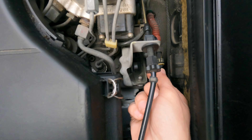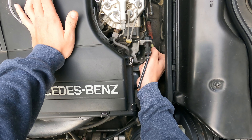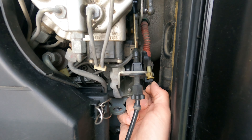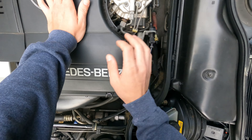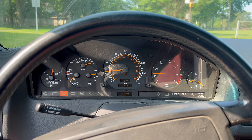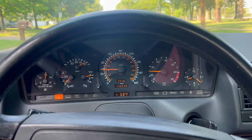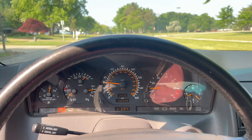It's fluctuating a little bit, so we're going to take a little bit of tension off. But remember, you don't want to make it too loose — you're going to put a little bit of play in your throttle. Now we've achieved a nice idle speed. She's jumping around because I believe I have a new vacuum leak, so be on the lookout for that. If you guys look, we have that bowden cable lined up just right.